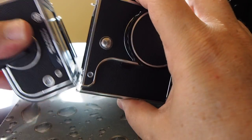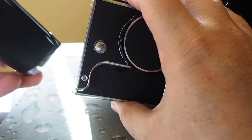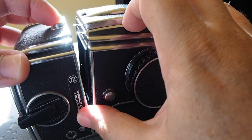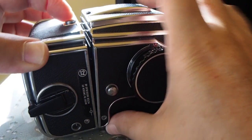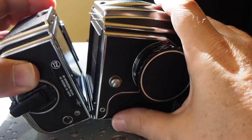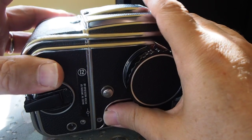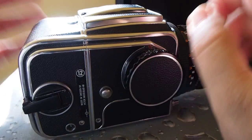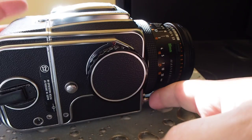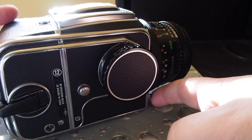Let's pretend that we have film in. I will put this carefully back in there — do not slam it in. Push this number 12 over to the right, put the cassette in like it should be, push it back, put it in, and release. That's caught now — it's cocked. Your shutter release is right here, and when I press it you'll hear the marvelous Hasselblad sound.